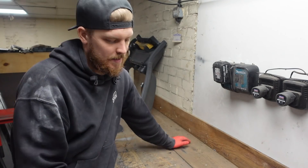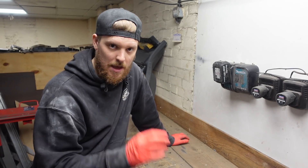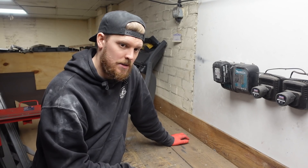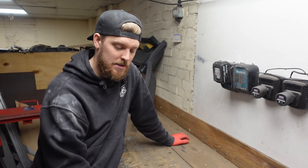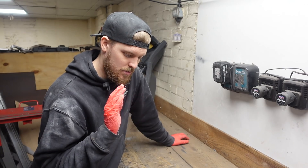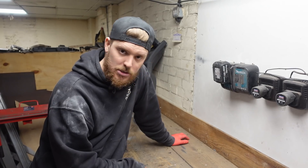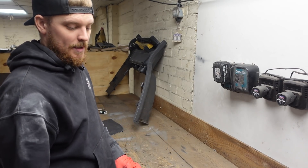It's time to go back over it with a fine surface filler. The one we're going to use is Upole Dolphin Glaze, which is recommended for use on SMC — the two work well together. This stuff is really thin, almost like water. It's two-pack again — two parts — so we'll mix some up and start laying it on. I've used this on another part to have a play with it, and it sands so nicely. Don't be afraid to put loads on to help you get the shape of the bumper that you want.